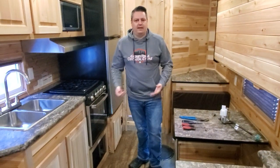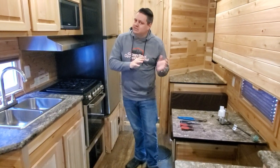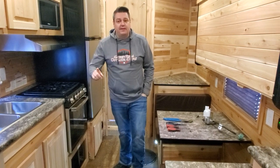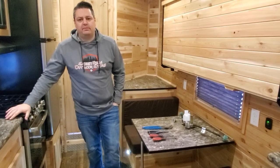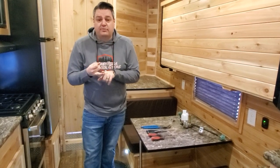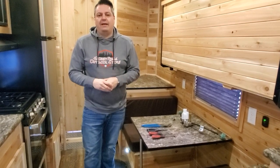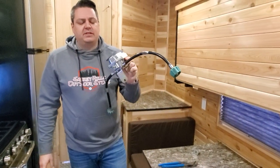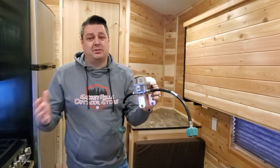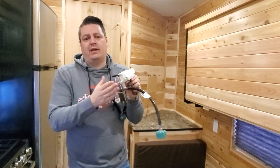Point number three is the one that most people will experience — the fan is running and it runs and runs and just blows cold air. The air is not getting hot at all. What will happen is it will shut off eventually and start up again. That is different from the limit switch issue. Why is it doing that? Very simple — it's not getting propane because the propane is empty, or because the regulator is frozen up, or the tanks are frozen up. Most commonly it's going to be a regulator. A lot of it has to do with propane quality or temperature swings. If you're going to be in the middle of nowhere, bring an extra regulator.